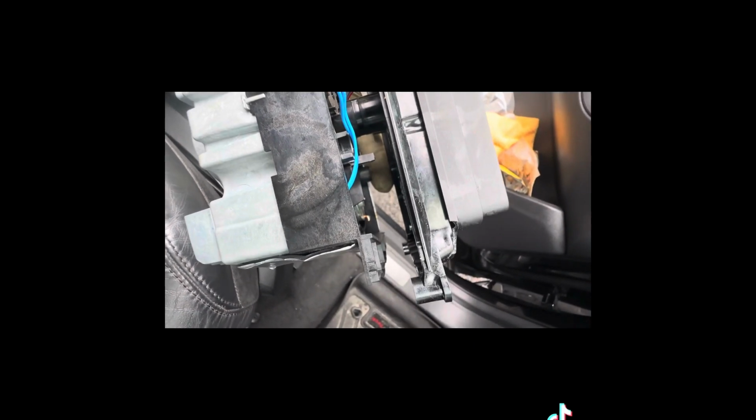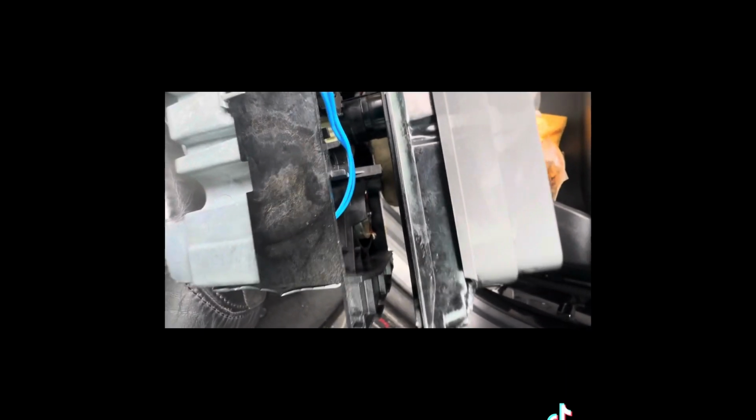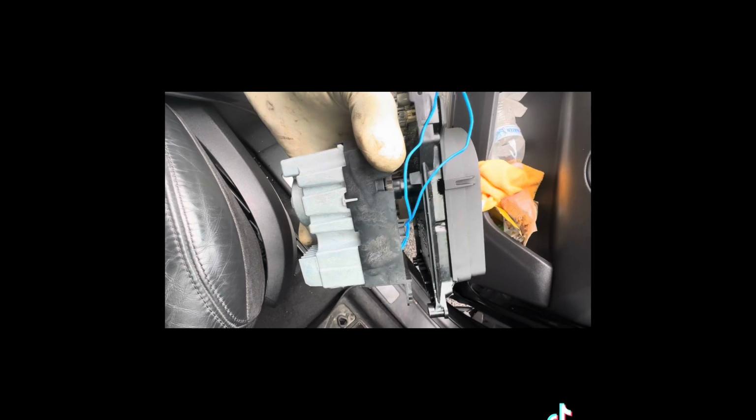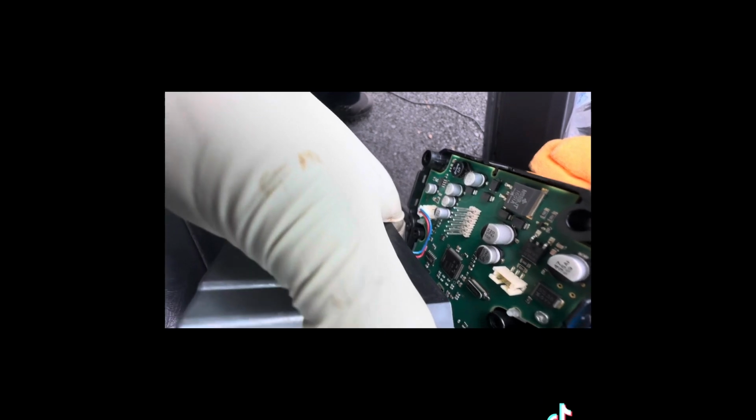The motor inside worked. When I give it power, it moves back and forth. So the problem now is the motor is not getting power when you press the brake. But the computer gives the code for this one. It should be this system right here, and it might have a problem anytime you press the brake.